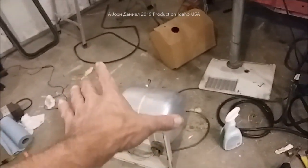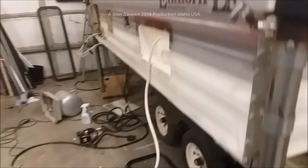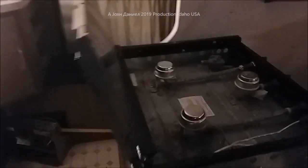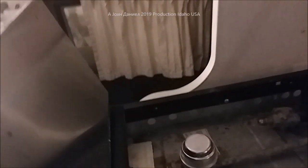The water heater will go back in and I'm going to do a foam insulation job on it for much higher efficiency, including adding an electric element. The shower is nice to have for when you're on the side of the highway. Back here is the original battery box — we're going to put three 35-amp-hour batteries in that. I'm rigging all of this for heavy wiring: one-ought gauge for our big runs. We're going to have a 2,000-watt inverter in here. The stove was fully pulled — it comes out with just a few screws.